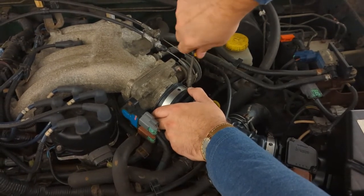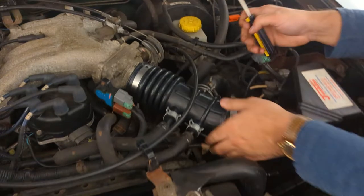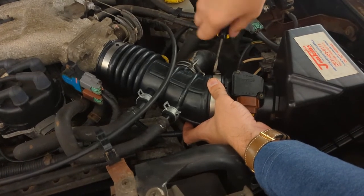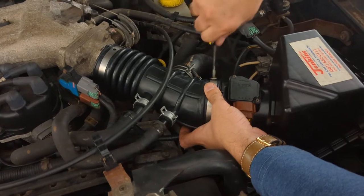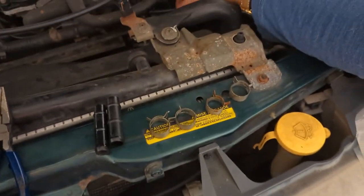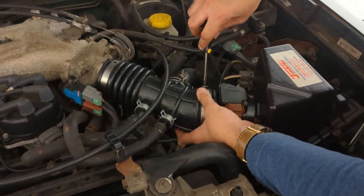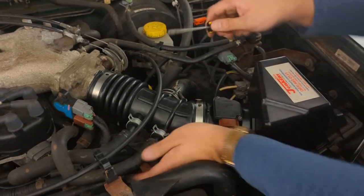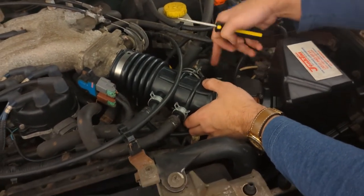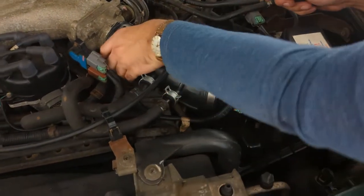So I've got my two flat head screws on the clamps on either side. You've got to keep it at an angle that's amenable to you doing this. Obviously it's easier if you want to use a socket on one of these — I'm just in a rush to go to Wegmans, so that's not going to happen. Let's tie it on one side, got my second side here. Then all we've got to do is get the vacuum lines on. There's one thing I missed on the vacuum lines — you can see there's little hose clamps over here. I've got to get another set of hose clamps on these. Really these are the hardest to secure. These are soft lines, so you can move them about. These are much more rigid — that's not moving anywhere. The air injection, that's a box over there, so that's not moving anywhere.